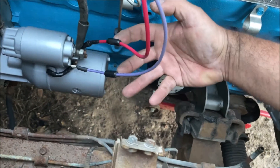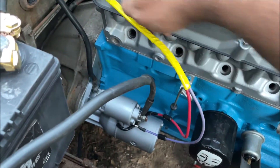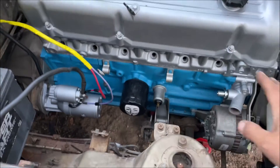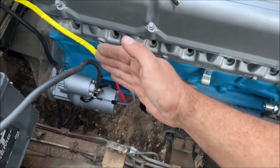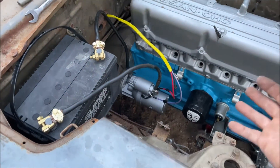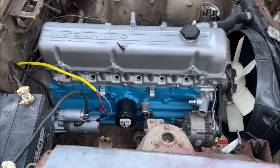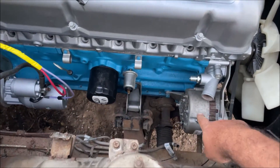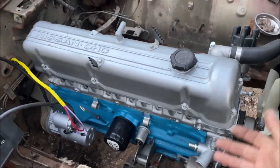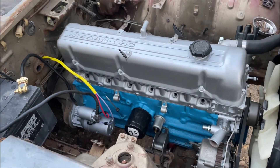If you wanted to fuse those two wires, there you go. You can see how we're wrapping the starter motor circuit in yellow tape. When we add the charging system wiring in the next video we'll do it in a different color, and you're going to see how they're all in there next to each other but completely separate. You see how simple the starter motor circuit is — when we flicked that button it worked the first time, perfect. The next video we're going to wire up the charging system or the ignition system. Hope you see how simple that is — please like and subscribe, thanks for watching.